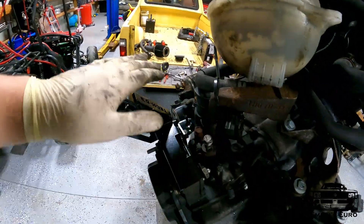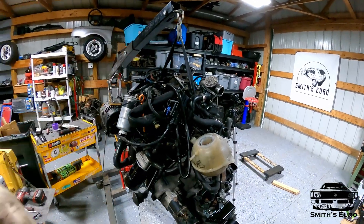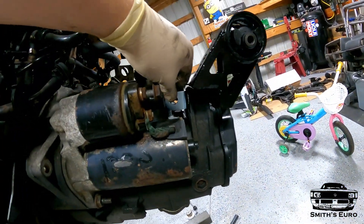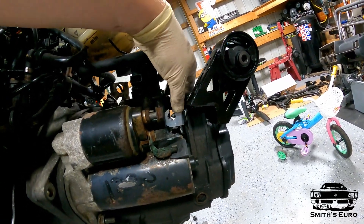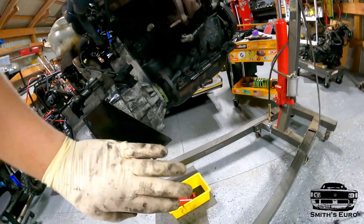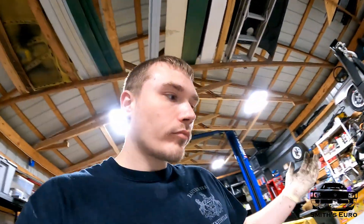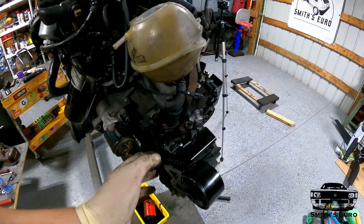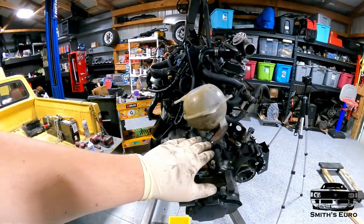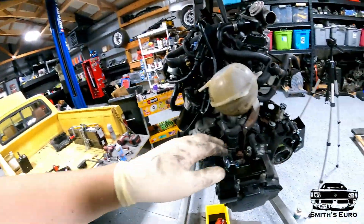This is the last piece — everything's on. The engine is now ready to drop into the truck. I'll take some miscellaneous stuff off, but that's not really video content. Here's how the clutch cable part looks coming through. You can see all the mounts are in place. The lower bolts on this mount I'm going to leave loosely in — I hope it can be done in the car. I didn't tighten this yet because the next video will be the O2J shift conversion — I'm going to be putting in a shifter box, cables from over here, and the shift tower going into the truck as well.